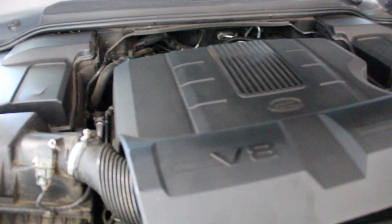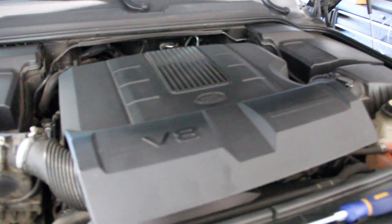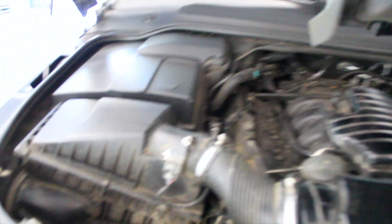I'm going to do some quick explaining on how to get to the water pump. The first thing we're going to do is take off this plastic cover — it just pulls up and pulls out. I've already deconstructed a lot of the engine here just for explaining purposes. Next we're going to unscrew this clamp right here and this one, and you'll just pull this plastic air box part out and put that off to the side.